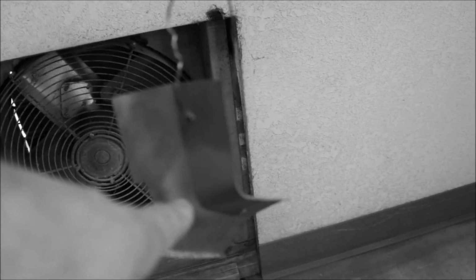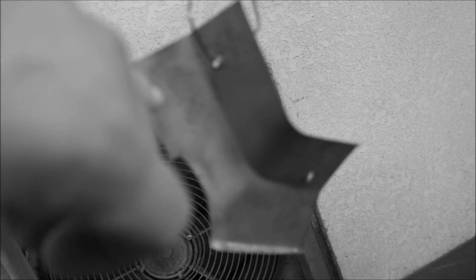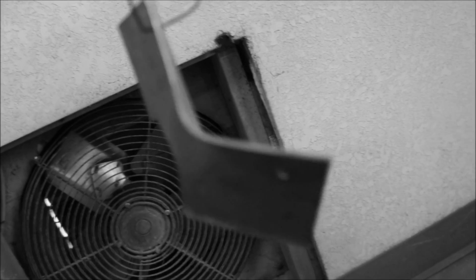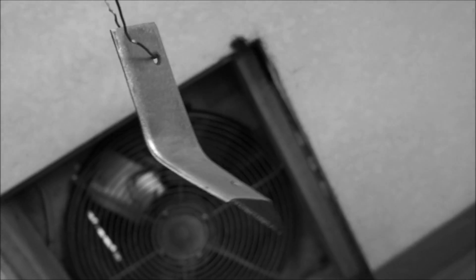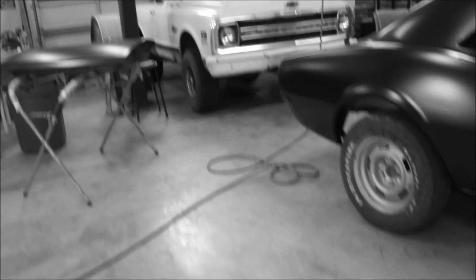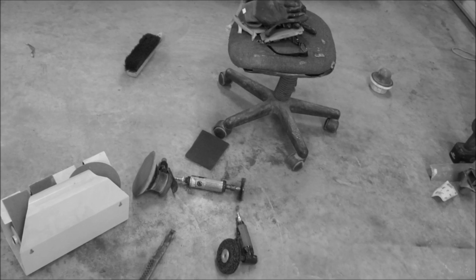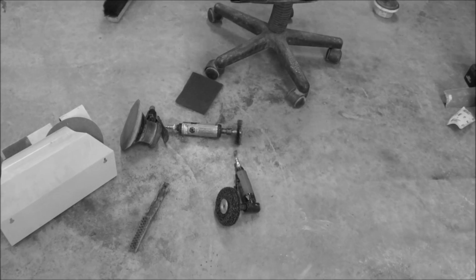I had these sandblasted, and then some of the pits that I didn't get, I went back over with a wire wheel. That's the back side, and then the front side, you guys saw what I did to that. So those little wheels work. These things are great for stripping. I know a lot of guys already know that, but if you don't, those things right there are money. They're better than anything else I've used. Of course, I haven't used flat discs and stuff like that, but those right there last a long time, so I really like them.